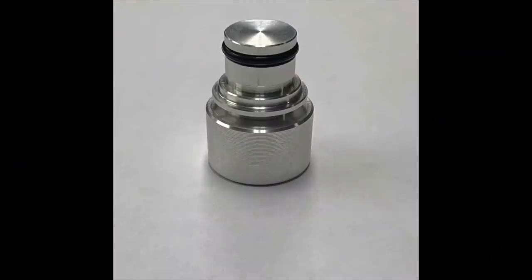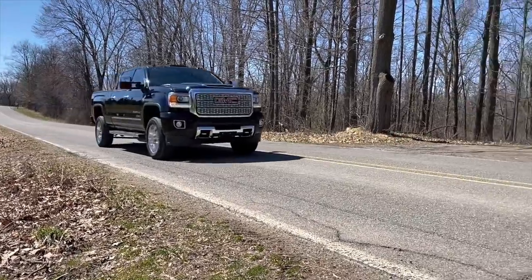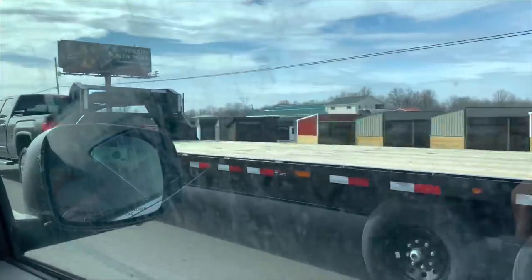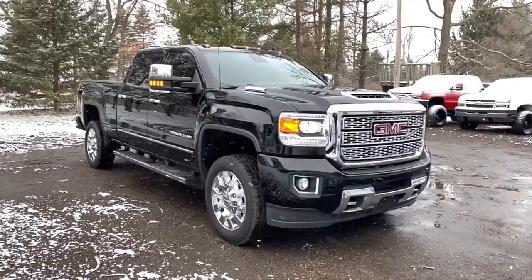I'm going to call Ryan at Ryan's Diesel Service — I'll leave a link in the description — to get his explanation, and then we'll install this and take it on a rip. So exactly what is this part and how does it benefit the transmission? Ryan explains: basically, the EPC fooler works by removing one of the solenoids and replacing it with a solid billet plug. What ends up happening is that between shifts as you go down the road, the transmission normally alternates pressure back and forth. This part allows the transmission to stay at max pressure all the time, so you don't have to worry about pressure dropping or spiking when you get on it. Absolutely, it could further damage the transmission if you didn't install it.